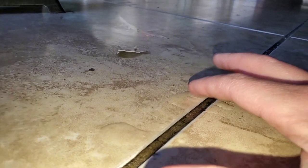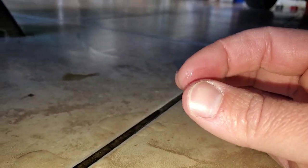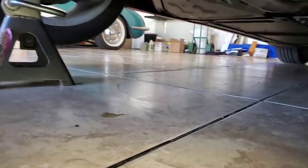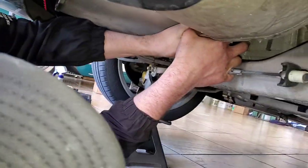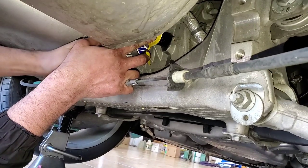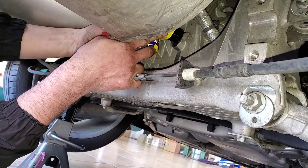You can see how pure and clean that lube is — you almost can't even see it until you feel it. Did you know it just changes color from heat? Of course, oxidation, the carbon. But that does not mean that the fluid is bad on the diff fluid — because the heat does change the color, but not like the trans fluid. When the trans fluid changes color, the fluid goes bad, but not on the diff fluid. The diff fluid color is always going to change after you put it in because of heat, but it's not going to have a chemical reaction like the trans fluid.